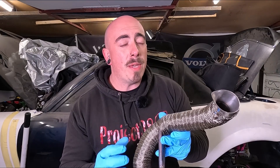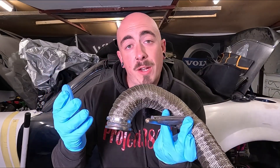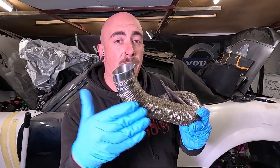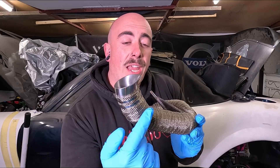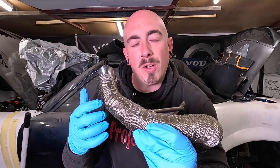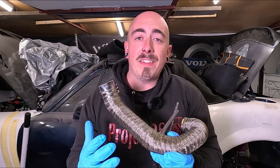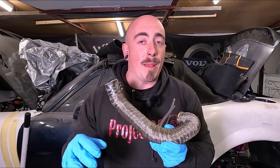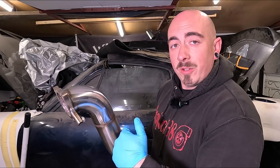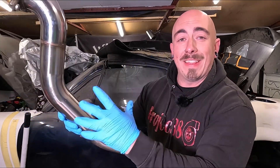Due to the way you wrap the pipe it will always look better from a certain angle. With the screamer pipe I started from the V-band end and ended at the tip. Because I'll be looking at it from this way it doesn't look anywhere near as stepped, whereas if you look at it the other way there is quite a stepped effect. So take this into consideration when you're starting to wrap your exhaust. Because I know I'm going to be looking at my downpipe from this angle, I want to start wrapping from this end just so it looks better from in the engine bay.